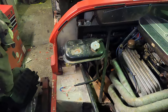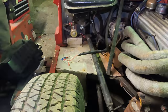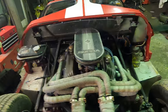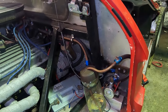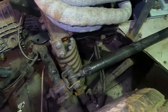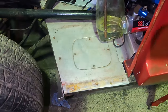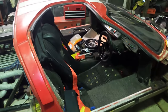The coolant reservoir, in my opinion, looks period and correct — very, very cool. It may not look correct to the year of the car, but maybe we can play around with that. There's an electric fuel pump under there. I think having both fuel pumps to one side would make it nicer. This rear firewall here is open, so it's not got any aluminium on the back of that — I would like to wrap that in aluminium to make it look a lot prettier. These front-to-rear rods, a bit like a four-link system, are rose-jointed and in very good condition. Ivan has hidden the fuel sender units underneath a plate, and he's made the fuel tanks himself — they are in fantastic condition, leak-tested and foam-filled, which is period correct.